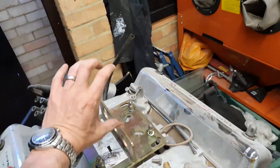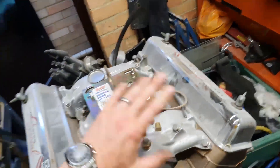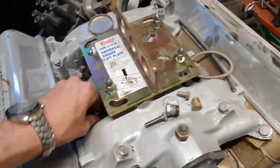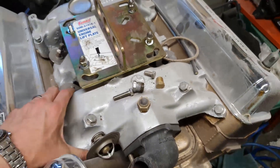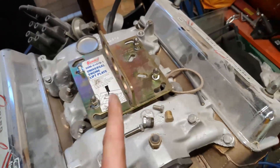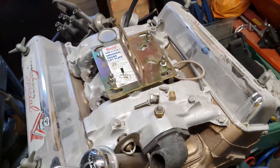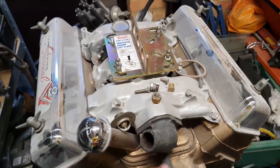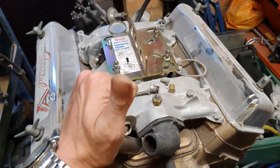Being that it's that low, I'll be able to get the nose of the jib in there, which means the height of the block should slide nicely into the car. I'm going to ensure that all the bolts for the intake manifold are tight before I lift it, because the last thing I want to do is rip the manifold off. The next stage is to disappear off to my mate's place and pick up the engine hoist — we have a car club engine hoist that's lent out to whichever of the club brothers needs it at any time.